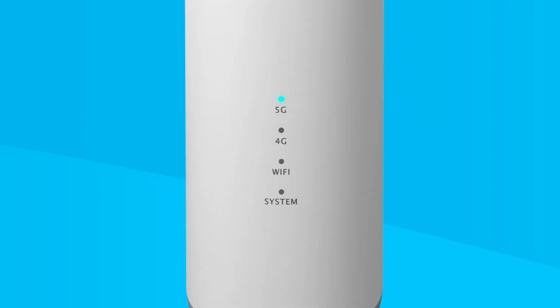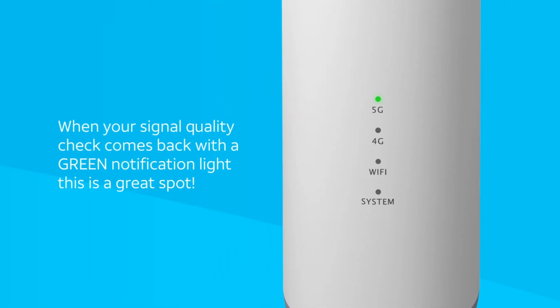If you're shown a blue light on your 5G gateway notification light, this location is good. While the spot may be good, we suggest you try testing other spots, such as high in your office, with clear sight to a window, away from obstructions and direct sunlight to find an even better signal. Again, try a new spot, and if you've unplugged the 5G gateway, it will rerun the test automatically when you power it back up. When your signal quality check comes back with a green notification light, this is a great spot.